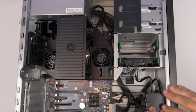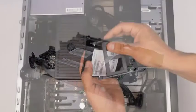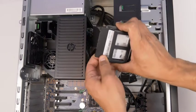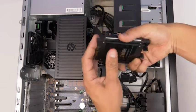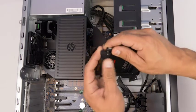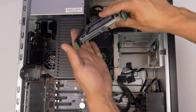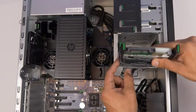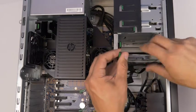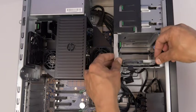If you are installing an SSD, the process is the same except that you will need a drive bay converter. To install the drive into the drive bay converter, you will need to mount the smaller SSD into the retention pins on the converter as shown. Once the SSD is installed, the rest of the process is the same as the regular hard drive installation, with the entire converter and SSD assembly taking the place of the regular hard drive.